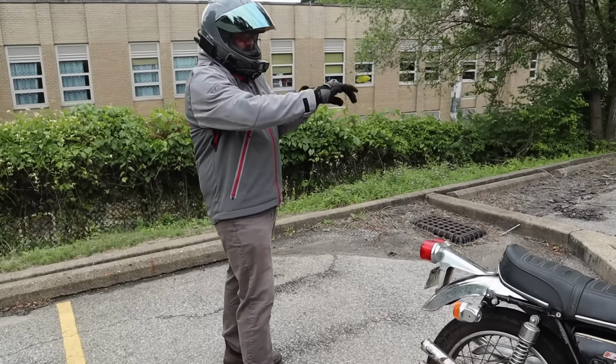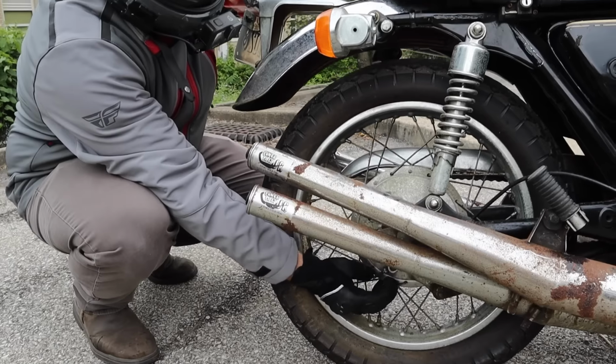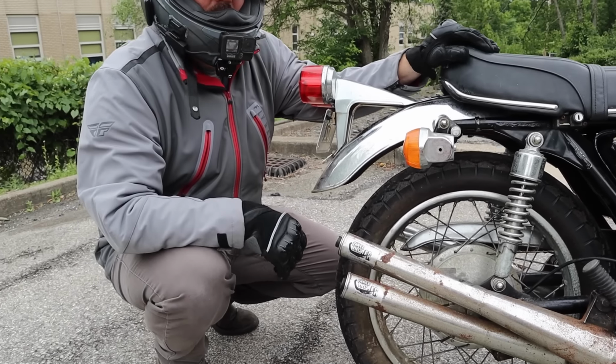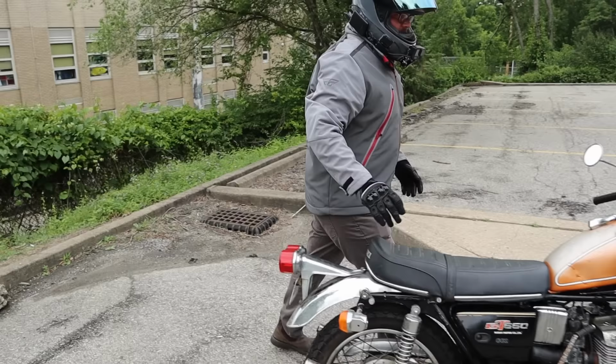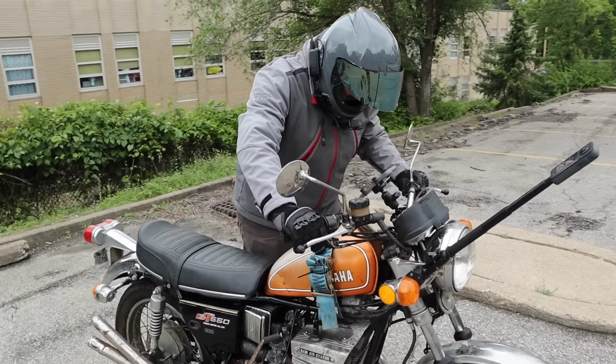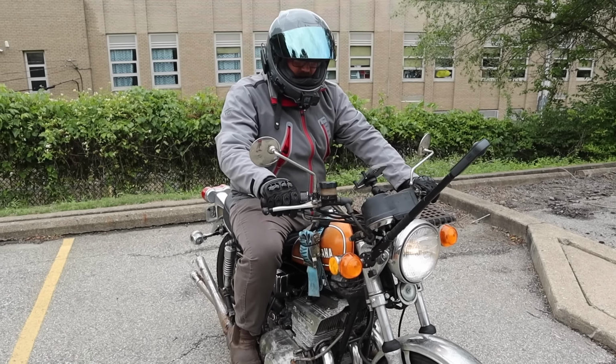Yeah, just tighten it down. It's that easy. We're just gonna take this adjuster nut here and turn that in a little bit, and now hopefully that'll give me a little more pressure on the brakes. One more spin for good measure. There we go. And the bike is not dragging yet, so let's take a spin here and see if that's any better. Oh, it feels better already.